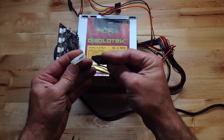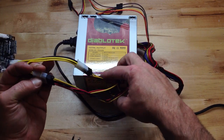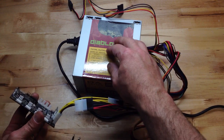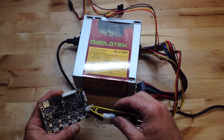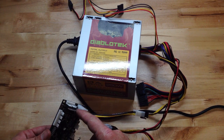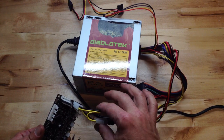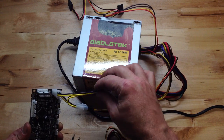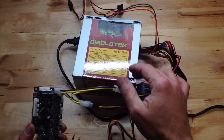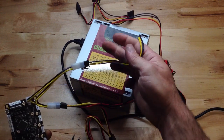We're going to plug this in here — notice there's only two pins. This is going to spread out the current between more wires and allow a lot of power to come through the power supply into our printer board. This is essential because the heater board on the print bed and the extruder heater — the UBIS hot end heater — draw a lot of power. We want big, beefy wire. Plus owners must use that plug, or go get a power supply with thicker wire, like 16 gauge, instead of the thin stuff.